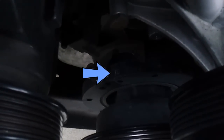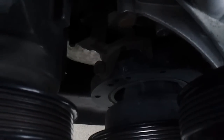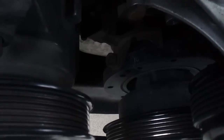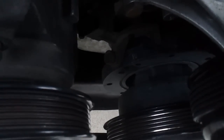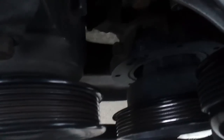You can see the 10-degree mark right in the center of your screen. We're looking at the harmonic balancer — I already painted it a while ago when I was rebuilding the engine. Basically, if you're rebuilding the engine you need to mark the 10-degree mark before you put the balancer on. It's a lot easier to paint it then. I'm going to have to repaint this so I can see it clearly, and I also want to mark the 14-degree mark, which is where I'll set it. I used a breaker bar and turned the engine manually clockwise to get to that mark. It's easier to work from the top when you're doing this.